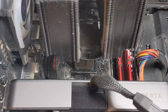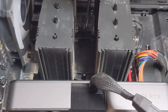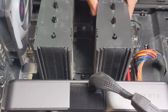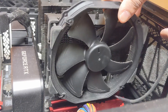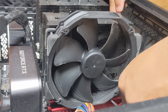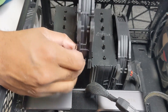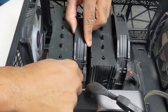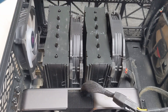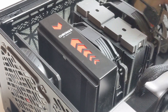Now for getting this beast of a tower cooler right back on. I'll line it up to the slot since the back brace is already on there. A couple of nice turns on each side — don't want to tighten too much on one side and have trouble tightening the other. Give it a good wiggle to make sure it's in place. And the fans — as you can see, this cooler does have some interesting fan clearance; you do need a wide case when using one of these. I like to use a screwdriver or a pair of chopsticks to help push down the fan connectors. And we get the aesthetic clips that magnetically lock right back on for that nice, continuous red look.